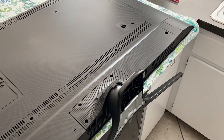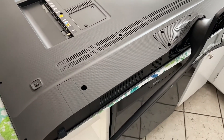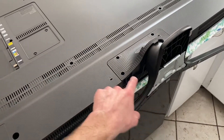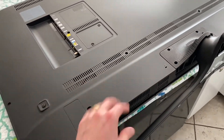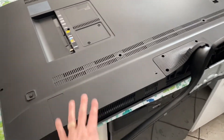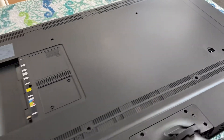The internal parts are heating up and what most people will say is just grab canned air and blow inside those vents. But the problem with that is, in the event that there is dirt inside here causing your vertical or horizontal lines, if you just use canned air to spray in these vents, chances are that dirt or debris will end up somewhere else inside the TV and cause further damage.